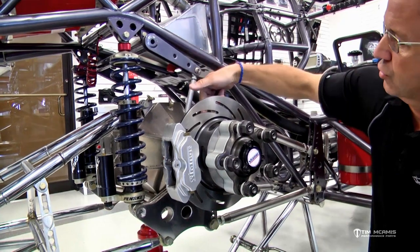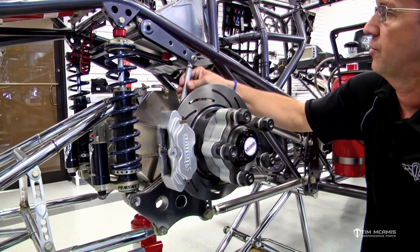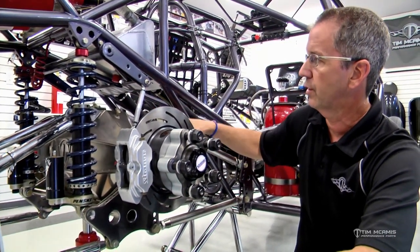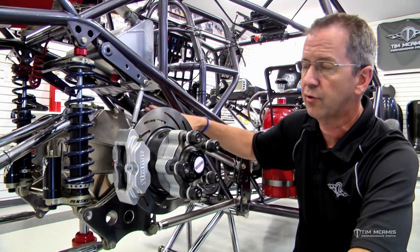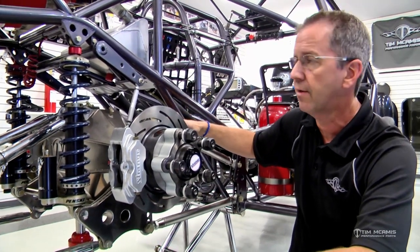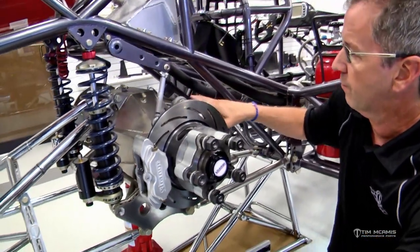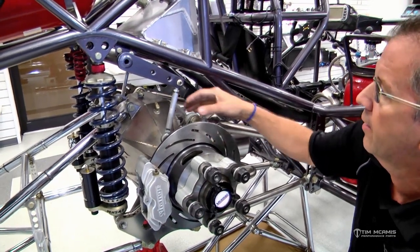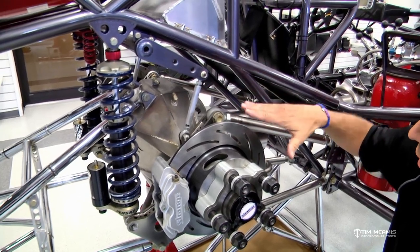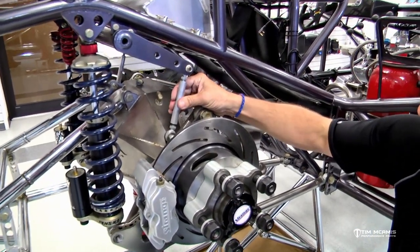Once this is all mounted and you've done your rear end alignment, it's time to set the anti-roll bar — the same way we set preload — with the rear end hanging on the shocks. You want all the weight off the housing with both tires and wheels hanging off. That gives you the neutral or preload position. Do the preload first. If you run a flat of negative, put that in, and then from that point neutral the sway bar so the housing has preload in it and the sway bar has no load on it.